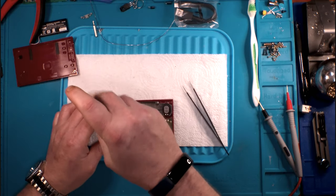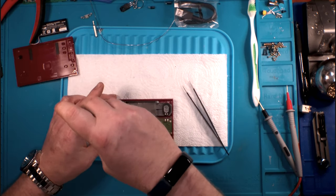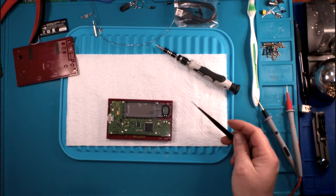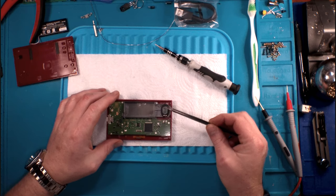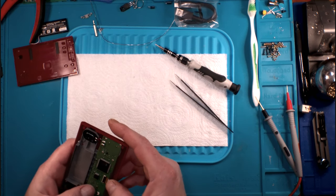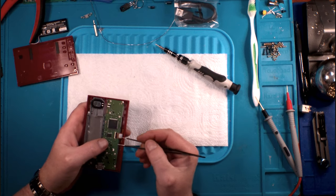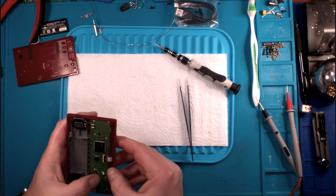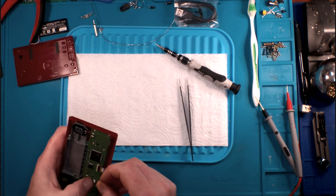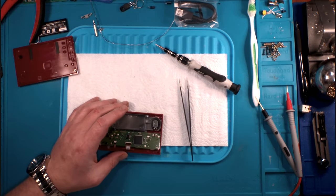However, could you theoretically get into it? Sure, you could. How hard would it be? How good are you at micro-soldering? Because that's what getting into this chip is going to come down to. I don't think it's going to be a situation where you would end up removing the board or removing the chip and having to reflow it back onto the board. I don't think it's that complicated at all. I don't believe that's the case, but I do think that you would have to solder quite a bit of jumper wires to this to get it to function the way that you want it to, and to play the games and the things. I don't know why I turn my soldering iron off when I'm fixing to need it.